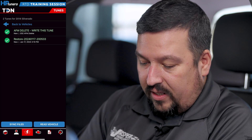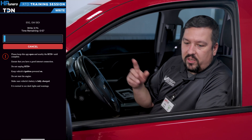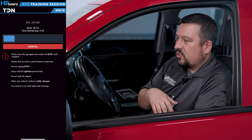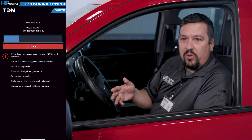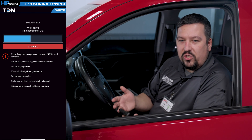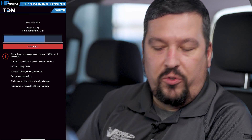All you need to do is select that and write the vehicle. This calibration that we're loading into the truck now is a calibration that was developed here at Jasper Engines to work hand-in-hand with your non-AFM Jasper engine. We want to ensure that you have as smooth of a customer experience as possible. What I really like about this RTD is that it provides a really smooth user interface and a very good experience. And when you're done with it, you can put it in your glove box and keep it as a diagnostic tool for the future.